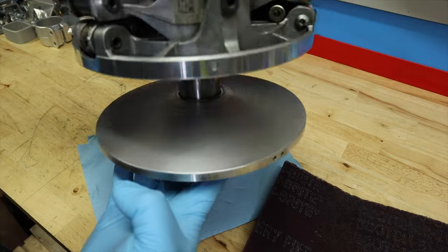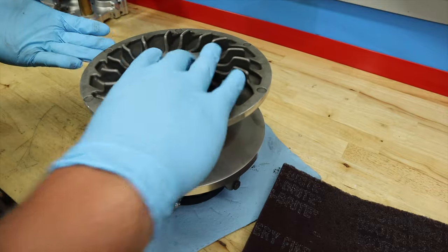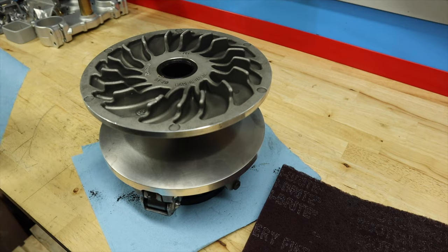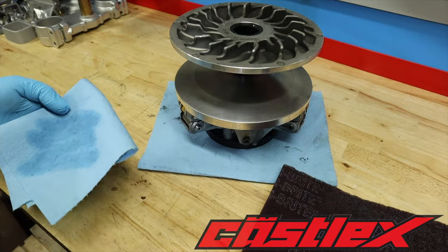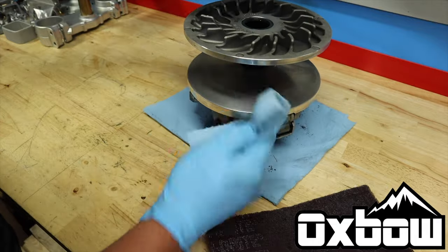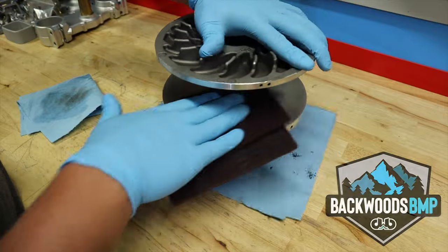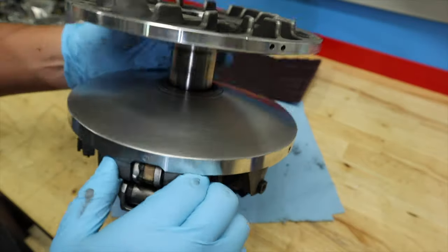As you can see, it looks really, really well. Once you get done cleaning it there, take your paper towel and some contact cleaner. I will link down below where you guys can get the Scotch-Brite pads, contact cleaner, all that good stuff. And you want to wipe this out really well — you don't want any oils in there, that's for sure. Take your time, clean this up, make it look purdy again. Nice, cleaned up, ready to rip clutch.